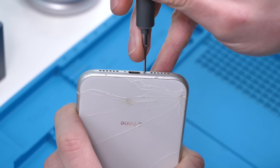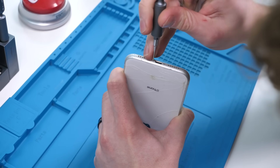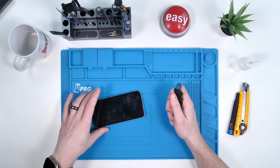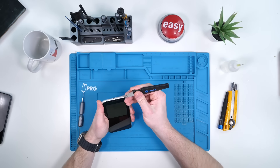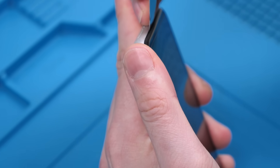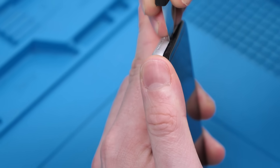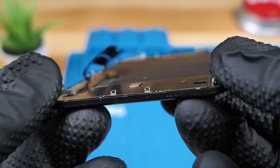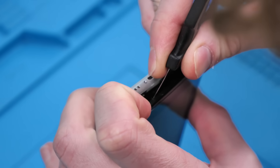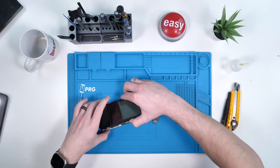That screw's a little bit elevated — I think someone's been in here. It's stripped. Of course, the screw is stripped. We'll unscrew the other one — and it's also stripped. Well, because we are replacing the screen already, I don't really care if it breaks. I'm not going to break it though; I have a little trick to get into these. Basically, you need your boy Jimmy. You take Jimmy and you just pull on the screen. You've got to be kind of forceful, but you can push back the clips to a point where you can still open the screen without even removing the screws — something I just picked up with experience.